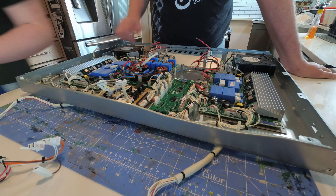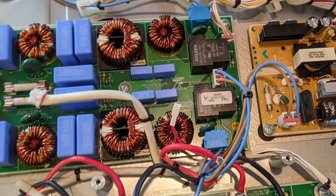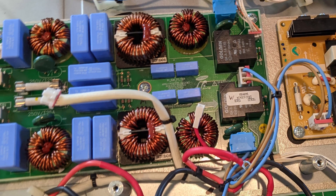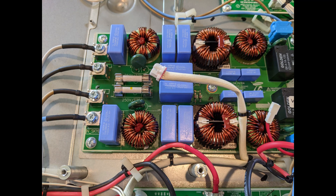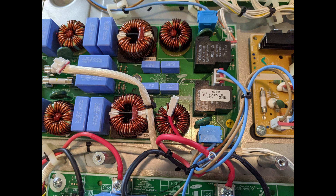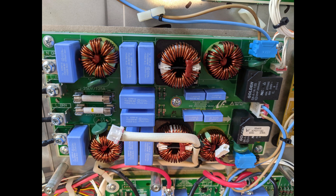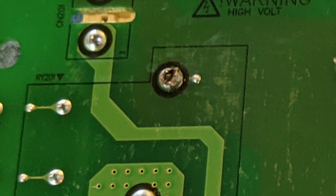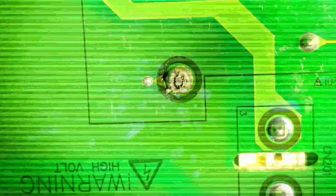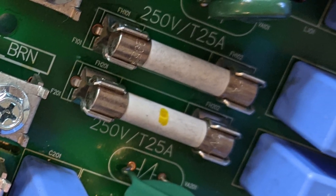There are left and right boards for each pair of elements. Between these are three boards: the display control board, the microcontroller board with all the tiny components, and at the back near the fan shroud is the main burner board — this is the one I had the problems with. The failure is on the back of the board, so it needs to come off. Disconnect the connectors and cables and remove the screws. I removed both the center and left board for inspection, since it was my left two burners that weren't working. On the back of the board, inspect the large solder pads for one that looks burned around the center. I inspected all the joints and also looked at the fronts for any obvious burned components, but I only saw the one bad joint. I also used an ohmmeter to test the fuses since I was in there, but they were fine.